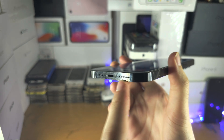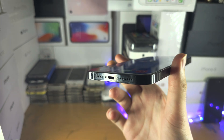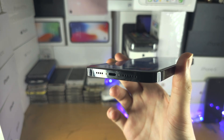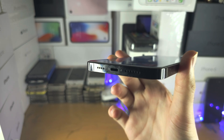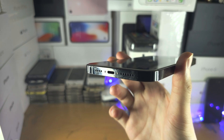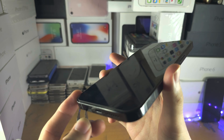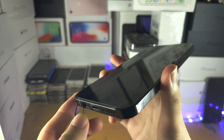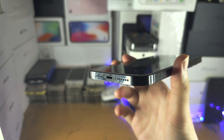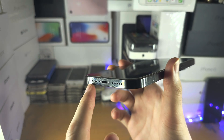At the bottom of the iPhone, the right grill is your speaker where sounds are played, and the left grill is actually the microphone. Check if this grill is covered or blocked — if it is, the microphone won't be able to pick up audio. Use tweezers, a pin, or the SIM ejector tool from your iPhone box to pick out any dust.